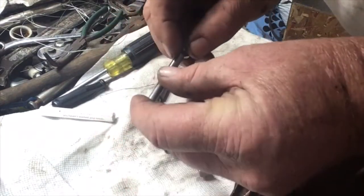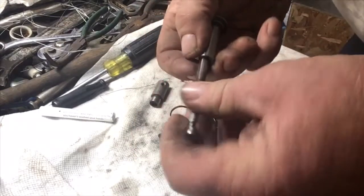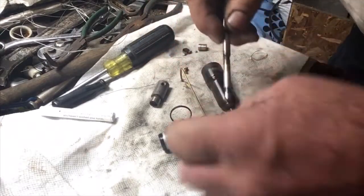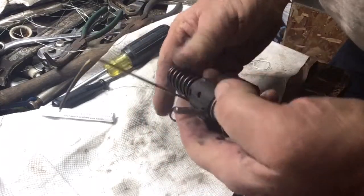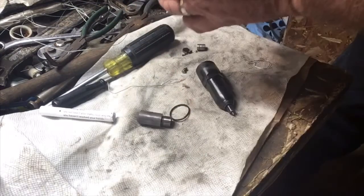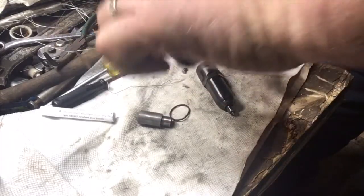This is your plunger and all the metering. There's a flat side on here that has to line up with the flat in that rack, or in the gear. For right now, I'm going to put this pin here, lines up with that groove in the bore. I'm going to put that in so it holds it all together. I'm going to try sliding this in. Oh, I pushed the gear out. Start over.